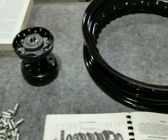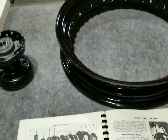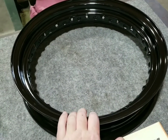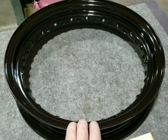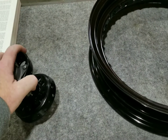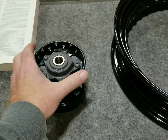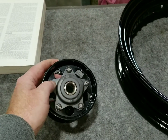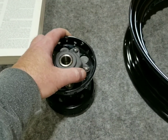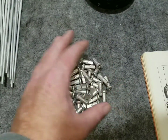Hello, it's Jesse here and we're going to be working on lacing and rebuilding a 16-inch wheel from a 1940. We've got the rim - a nice repainted black Kelsey Hayes rim for 16 inch - and then a step hub from 1938 to 1940, because in '41 they changed. It's been restored with new components, new bearings, a nice parkerized star on the end, correct round head screws, and a cadmium set of spokes and nipples.